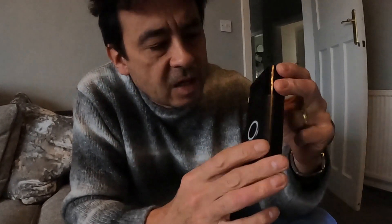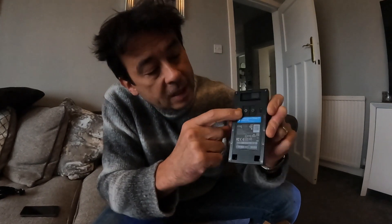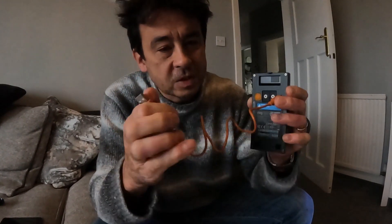There's one main important thing I've noticed. On the original Doorbell 2 you've got these two connections for when you hardwire it, and this is where I bought this resistor to wire in series for protection. To get the battery out you would normally undo this cover, pull the little tab, and there's your battery. However on the new one I can't figure out how to take the cover off - and I realize you're not supposed to. If you look at the back there's your charging port, still the two connections for up to 24 volts AC hardwired, and there's a reset button in orange. You could actually just connect a charger into it full time and run it that way.